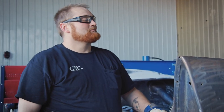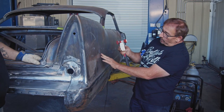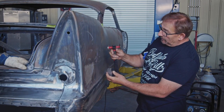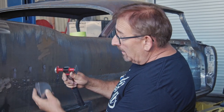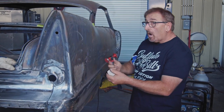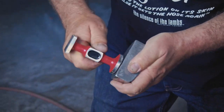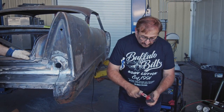George is going to be inside with the dolly — I'll be out here with the hammer and the torch. He's going to look for the red glowing spot I create with our torch. Then I'm going to come out on the outside and start tapping down on this panel. If the dolly wasn't in there backing it up while it's glowing red, one hit and I'd have an inside dent the shape of this hammer — game over. Whether you're using heat or not using heat, a dolly-and-hammer is a process. When you do that to the metal, it forces it all together and shrinks it — that's why it's called a shrinking hammer.